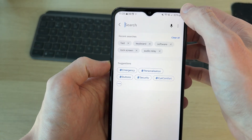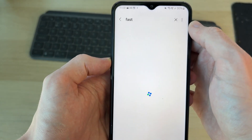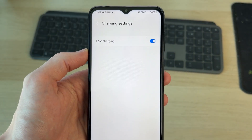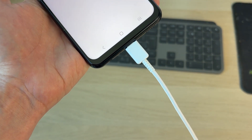If you're struggling to find this setting, press back twice, then press Search in the top right and type in 'fast' or 'fast charging' — you should be able to locate the setting. Tap on it and enable it, then plug in your phone and it will be fast charging. Note that you will need to be using a fast charger.